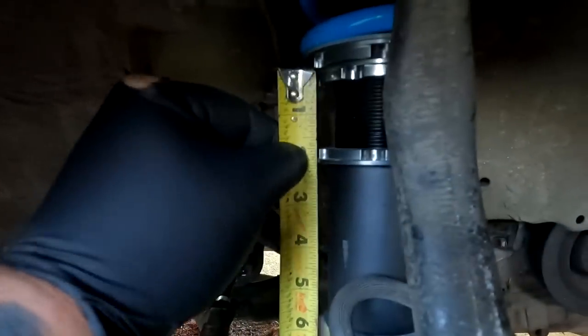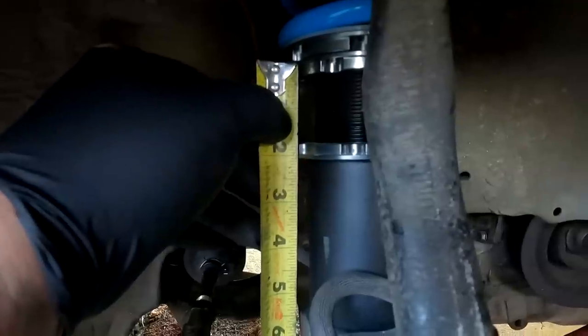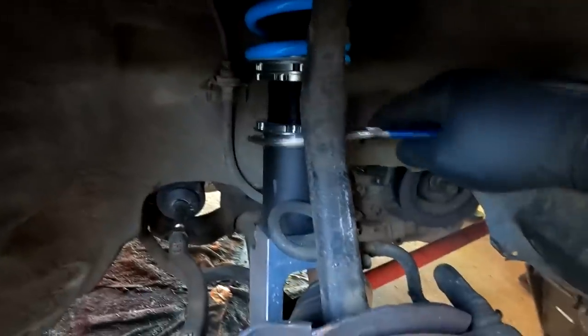But Herb just stopped by real quick, and I'm just trying to button up the front suspension. So on this side, where are we at? Where did we start? I didn't touch this side yet. So this side, from the top of the sleeve, we're at 2 inches. So I went 1/2 inch up on the other side. I'm gonna adjust the same for this.